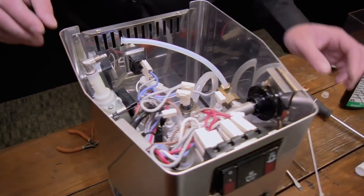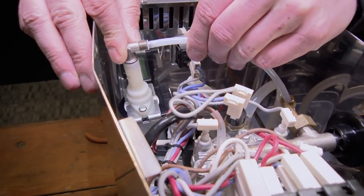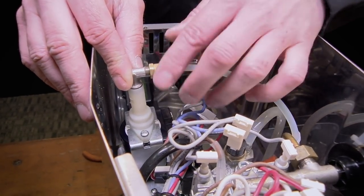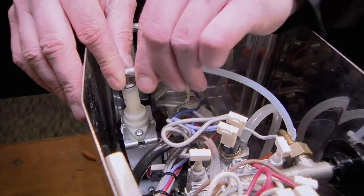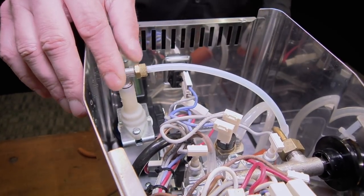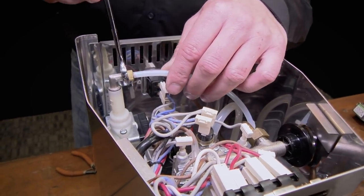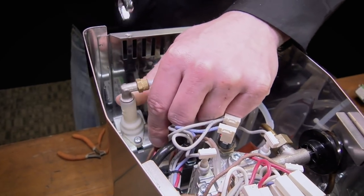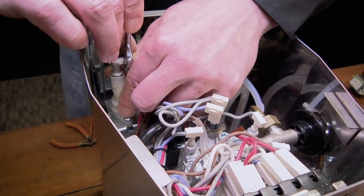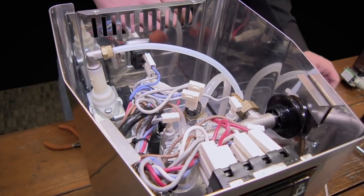The bracket's back in there — the pump has been replaced. Now we're just going to slide this tubing back onto the neck and start threading the nut on until we can't turn it anymore with our fingers. Then take the 12 millimeter wrench and hold the neck and go until it stops. There's really nothing you can do by over-tightening it, but you just want to make sure that the flare is sealed up against the elbow.